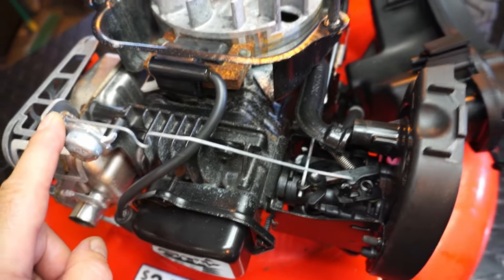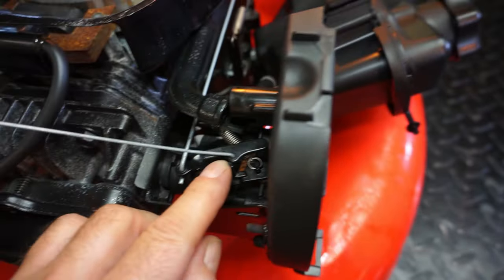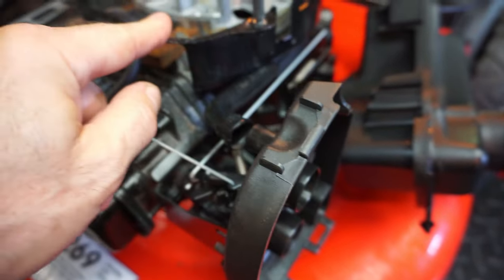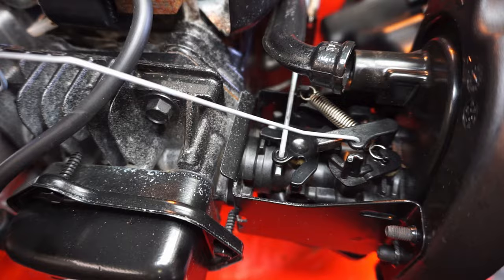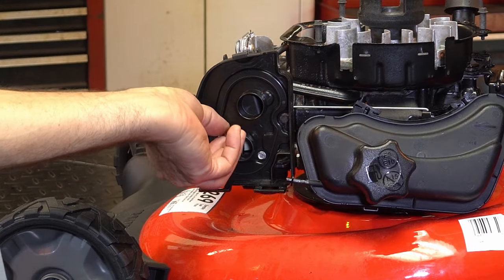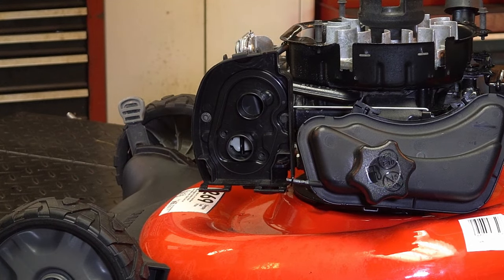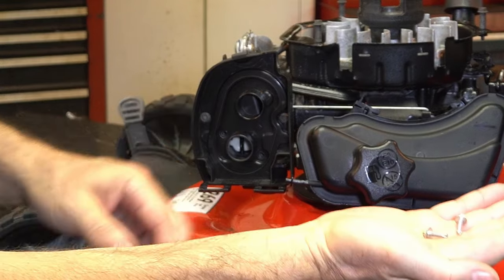So this is the automatic choke — that's your choke stove. It gets hot. The spring metal in there expands and contracts with heat and cooling. It connects over here to the top one — there's your choke blade. That's your vent from your crankcase. The throttle is the lower one. I don't use zip guns for this stuff — you'll strip things out. The silver ones are the smaller ones, holding this whole plastic carburetor to the plastic housing. These are the ones with the steel threads — fine threads — while those are like plastic wood-type screws.